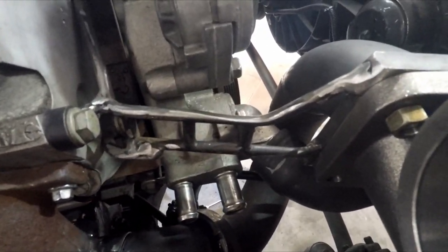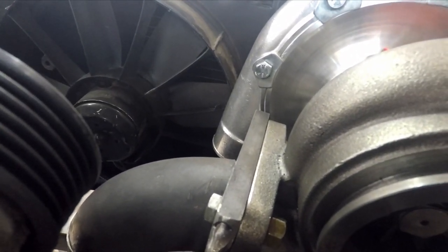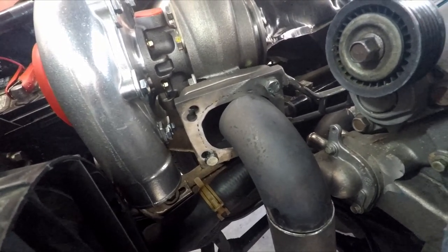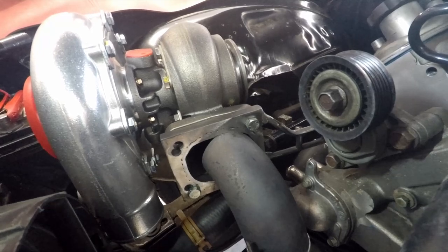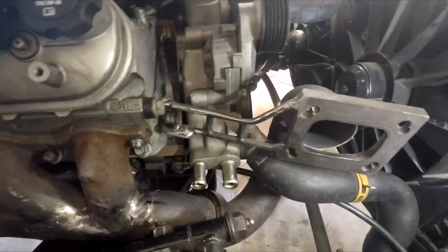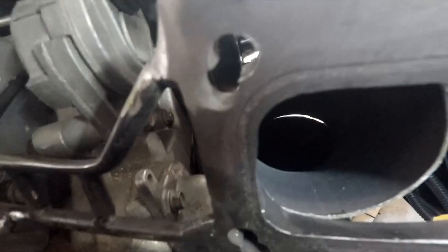Things are starting to come together now. We've got to route it underneath the heater hose fittings, underneath the thermostat housing and a little rad hose, and then we're going to go into our merge. I have this piece sitting in here but I think we're gonna merge in here somewhere. I've got a bit of a piece of the old merge I might actually use. This is going to be challenging to fab up. I think what we'll do is remove the turbo now, tack some things in place, look at creating that merge, and then start working on feeding in the driver side.